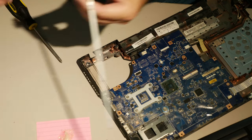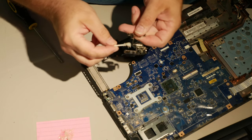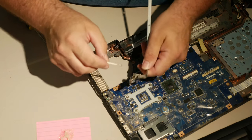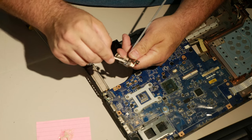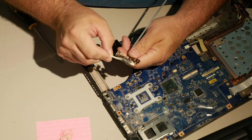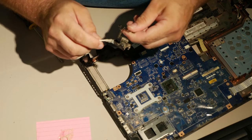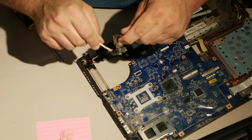Let's see. This hinge is disgusting, but we need to reinforce the crumbled plastic on the side here. So the plastic that crumbled, you have to rebuild with epoxy. Alright. Rebuild that with epoxy. It's disgusting, but it has to be done. Keep in mind, this is going to go in a relatively tight space, so you don't want to put too much excess epoxy. But you want it to have structural integrity, which means it has to cover up that crack. The crack goes all the way around. You have to get it to cover up that crack or it's useless.